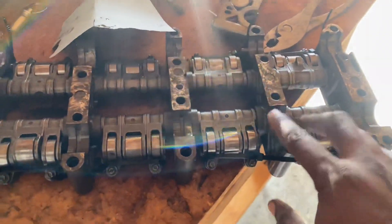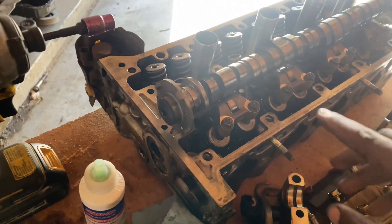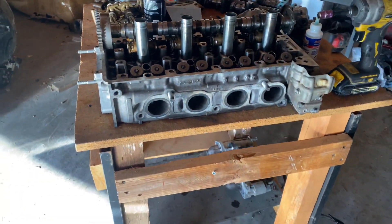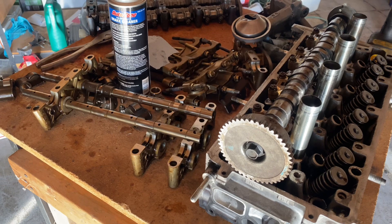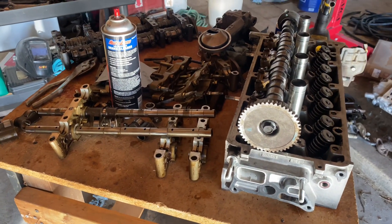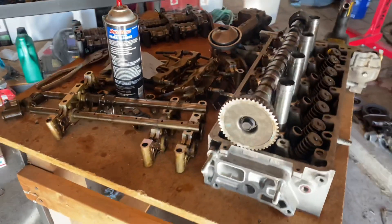To wrap up this video: I went over the rocker arm assembly, got them all done and tied up with zip ties, ready for install when we put the head on. I went over the VTEC killer setup — essentially it just uses the one center cam the entire time. You can make power with it but you'll probably waste a lot of gas since you're running the high lobe all the time. Next video we'll be running the oil pump, putting in the head studs, getting everything tightened up, and hopefully installing the oil pump chain. If you haven't already, like, share, comment, subscribe, and check out parts one through four to get caught up.